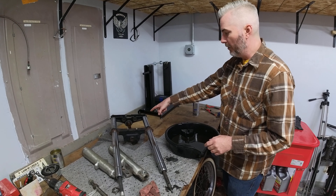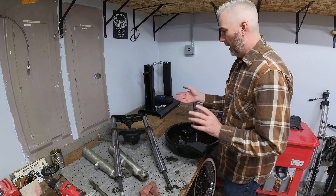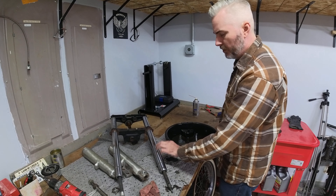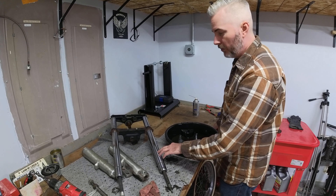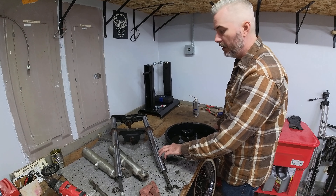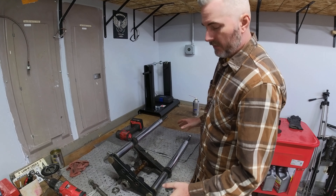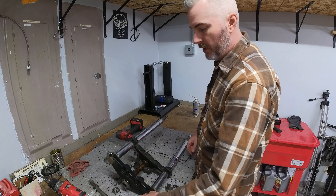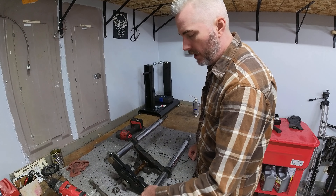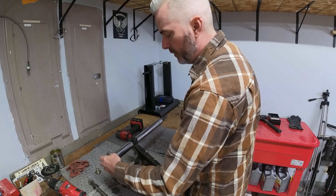Next I'm going to get this tray out of the way, grab my wrench, and get these caps apart so I can get these tubes removed and have the trees separated so I can clean everything up. The tubes look like they're replacement tubes and they look like they're in pretty good shape — I'd like to use these again, but I do need to get them torn down the rest of the way. These top nuts are actually just hand-tightened in place — when I took this bike apart I didn't torque these back down, so I'll unscrew those by hand.